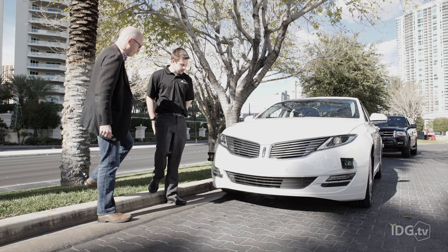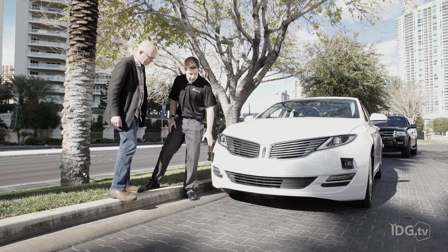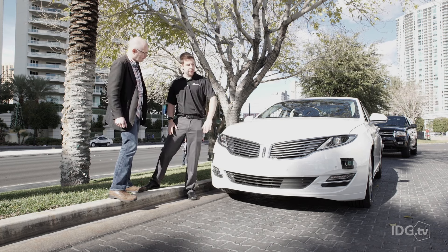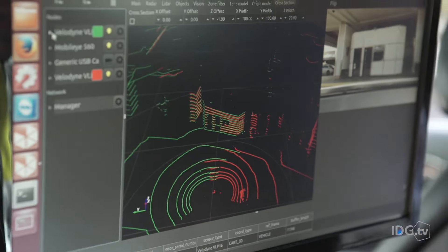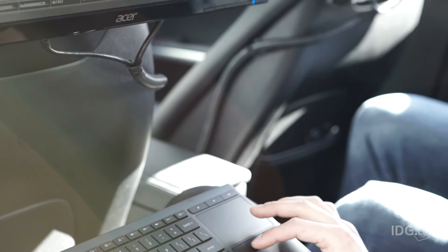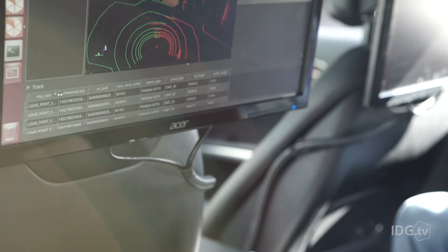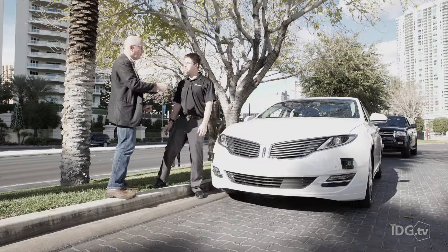On the front you'll see two laser scanners. These are time-of-flight lasers with 16 segments, integrated into the bumper. They're used to give the car the ability to see its 3D surroundings. These are how self-driving cars see — smaller versions of the big spinning units seen on previous generations — one of many components used to enable autonomy.